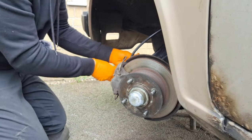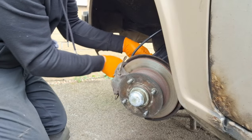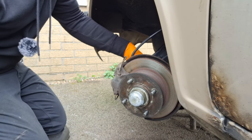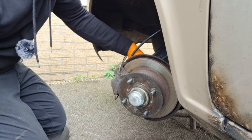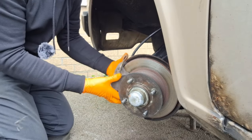And the interior, still got to put the radio back in because it's wired slightly different, and I need to look up for the clock. It's got three wires to it. I can't remember if one was ignition and one was, well, it wouldn't be battery live anyway, but I don't remember it ever going off in the other car. I think it was on all the time. Just an LCD, it doesn't take any power.